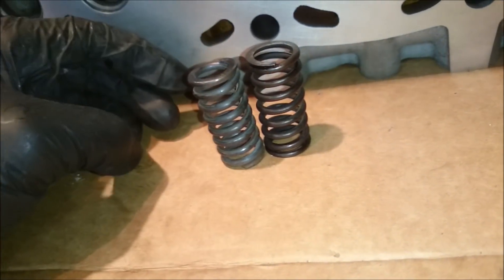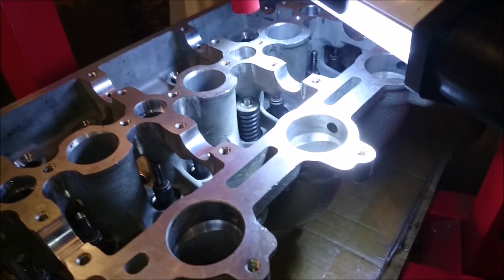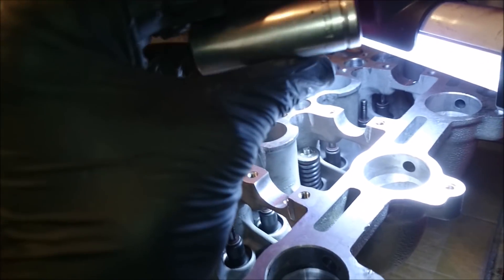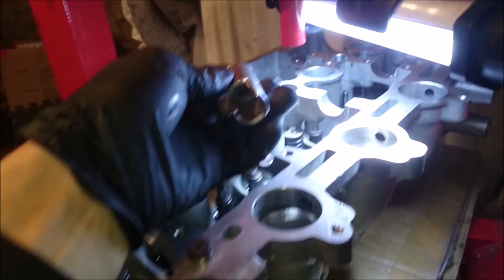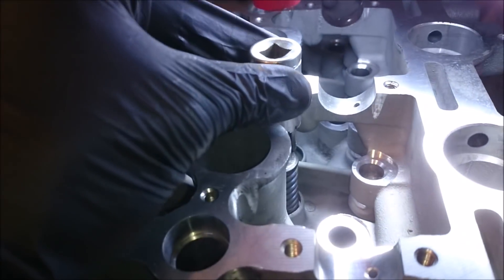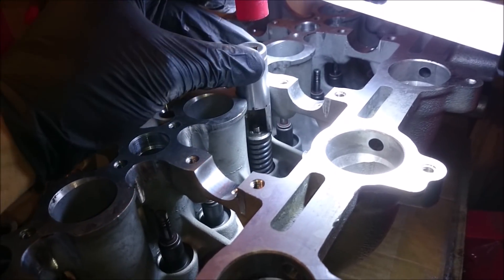The tricky bit is fitting them in there. So here's my little setup — I did one to practice before I showed you. The key to this little setup is this: a rather butchered 15 millimetre socket — my dad's old set, sorry dad. As you can see, it's taking a fair old chunk off that so that it sits in there. The space to get the sockets in, because of the cutout here, is very small — nothing bigger than a 15 millimetre.